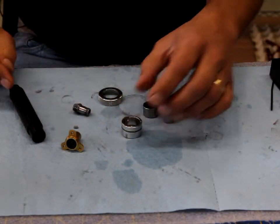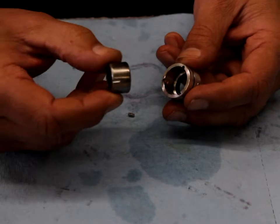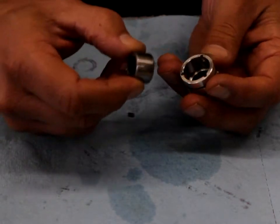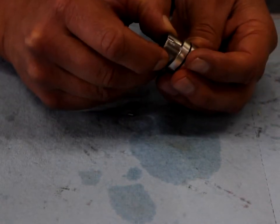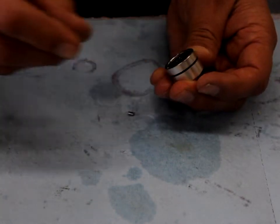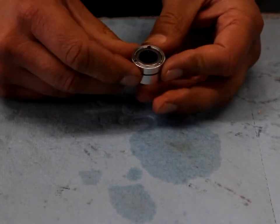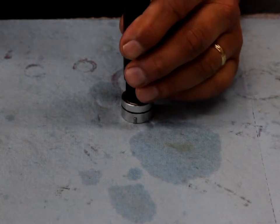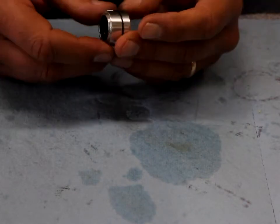I'll turn this around and make sure the seal is all the way in with no gaps, and then I'm ready to put the clutch in. Once the seal is seated in the clutch housing, you'll take your clutch and notice there's a pin slot cut in one end. We want to align that slot with one of the holes in the clutch housing, carefully turning the clutch so those holes line up to make a complete circle to accept the small clutch dowel. Once you get the pin to go into the hole, take the blunt end of the seal tool and just tap the clutch lightly to make sure it's seated all the way up against that main seal.